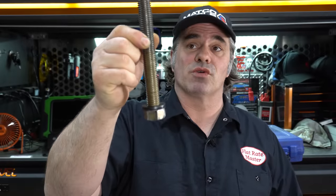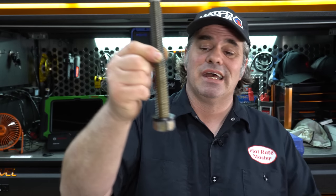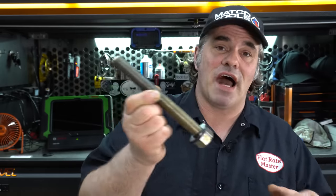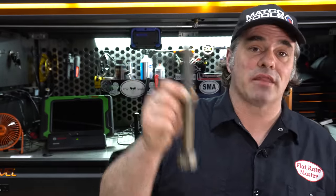There is a rather large difference in adapters. The coarse thread forcing screw that Astro uses has been fine — I haven't had any trouble out of it whatsoever. The OTC uses a cone-shape two-piece bearing that allows it to rotate; put a little gear oil on there and it works fine. I've only had to replace those washers once, and I had to replace the forcing screw on the OTC once, but that was when everybody in the shop was using it and I think somebody messed it up. I've got a spare forcing screw for it, but I have not had any trouble out of the Astro.